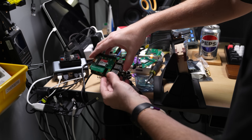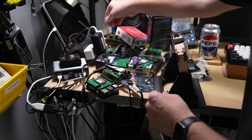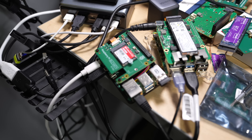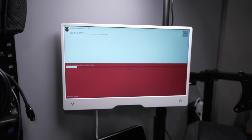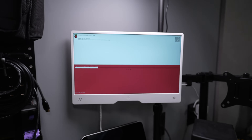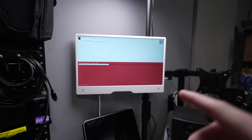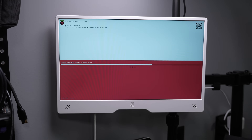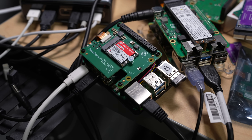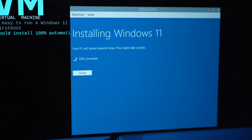New idea — I'm going to use an NVMe drive instead of microSD, because it was just taking forever. And I realized when you're booting Windows off microSD, that's going to be incredibly slow too. I also put a proper cooler on the Pi so I can ditch the fan. I'm using Raspberry Pi's net installer to set up the NVMe. You can change the boot order and boot device by holding shift at boot on the Pi. It's still slow, but very slightly less slow.